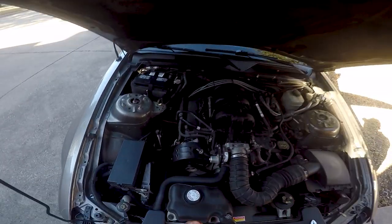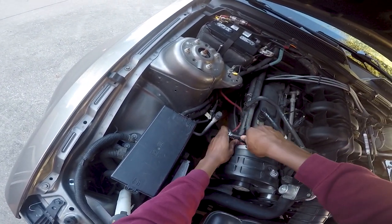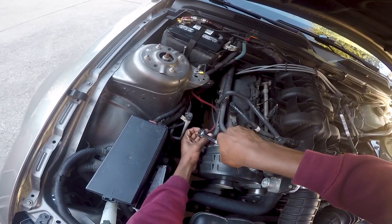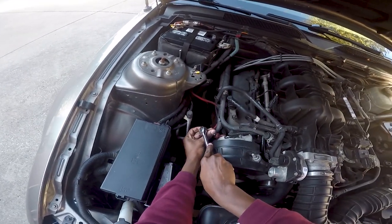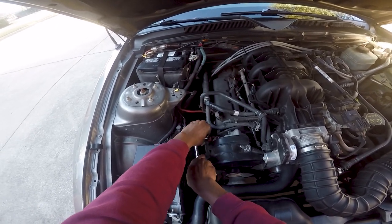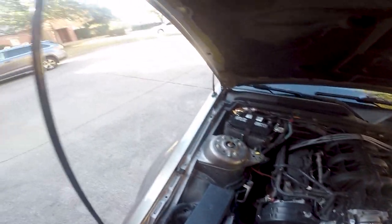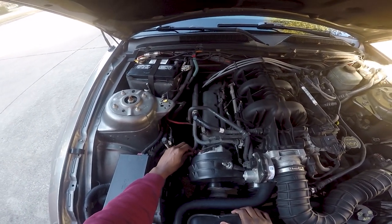But yeah, replacing an alternator, I'm not really worried about it. This is maybe one of the easiest things to change on a car, besides a battery. I also need to check the fuse and make sure one of the fuses didn't blow, because I still don't want to believe that an alternator went out this fast. But I know these alternators are really crappy.